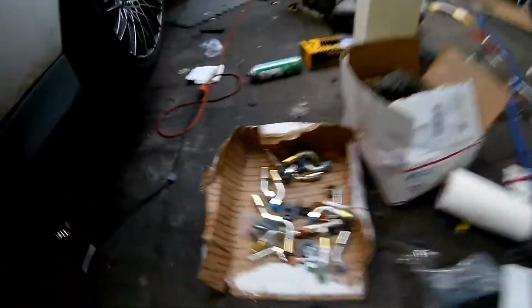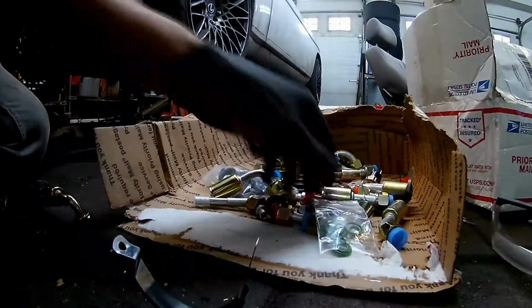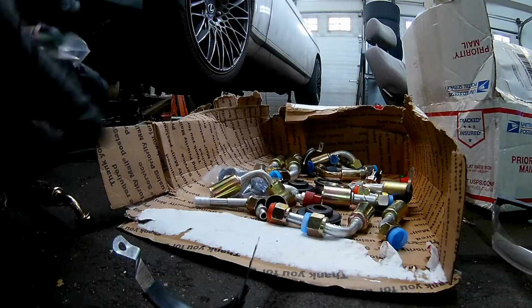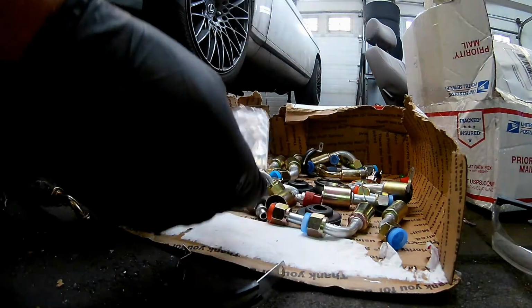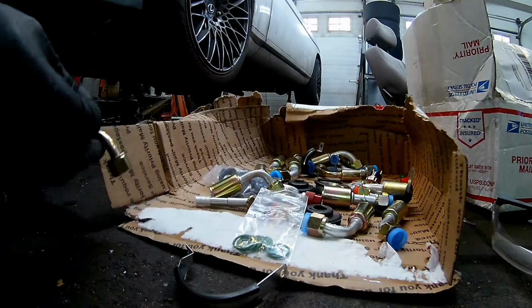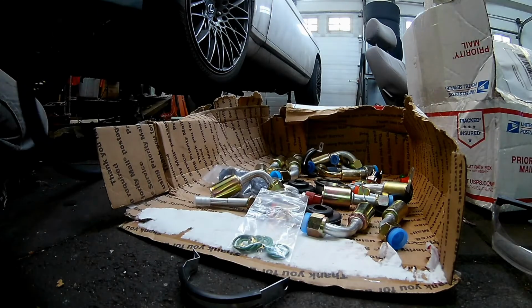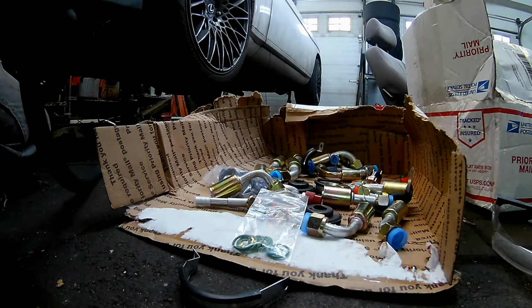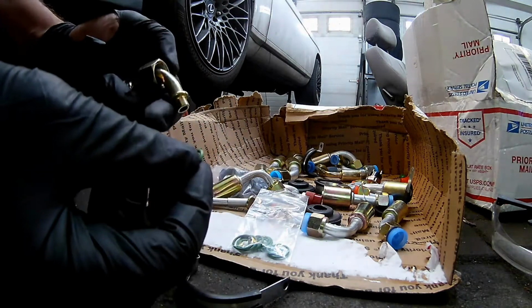So this kit comes with O-rings. I'll put the link in the description. There's O-rings for the 8s, the 10s, and the 6s. 6s are little guys. So I'll go get some oil, but you'll want to put some AC oil on these before you tighten everything down.